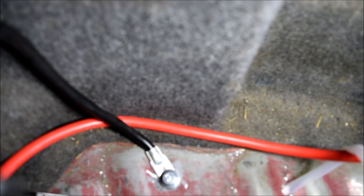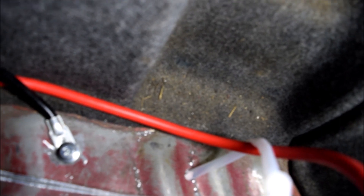Just like that, we're all done. Got the battery hooked up. I ran the ground just behind the box so it would be hidden. Grounded down the paint, put a bolt through, and then put a hole for the breather tube. So far everything looks good. When I hooked up the battery, the alarm started going off. Let's get a first start.